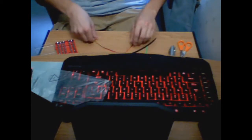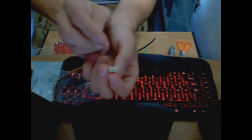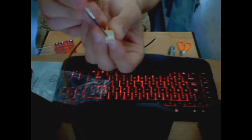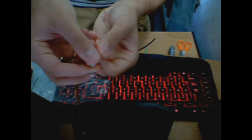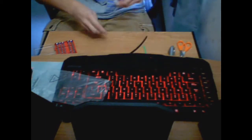There are tiny little tabs on the top of the connector. You're not going to touch those — they have nothing to do with the sleeving. You want to take your screwdriver and poke through the wire retention clips to release each wire. You don't want to pull the wires out until you hear or see them fully come out of place, because it will ruin the wire prongs and you won't be able to sleeve it. They won't be able to go back into the connector, and you'll have to crimp on new connectors, which is a pain.